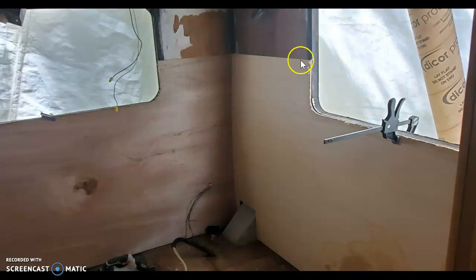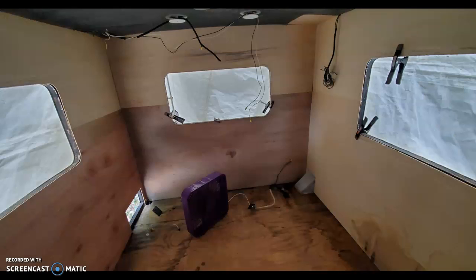We kept it braced in with our bodies, and then we used the Sawzall and trimmed along the framing, so we had exact cuts for our windows. This is when we're still in our dry-in spell. And here it is before we do any gluing. It's fit in so tight you didn't even need clamps in some of the areas.